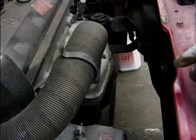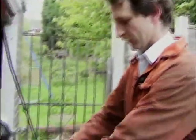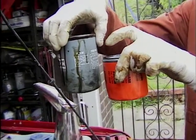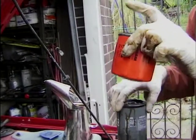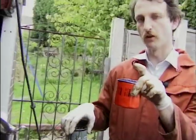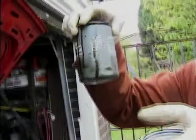That's all cleaned up. Pop the new one back on. Just before I fit it, what I wanted to point out is that these two filters are of different sizes. Normally that would make a difference, apart from the fact that I do know that Volkswagen have changed the specification on oil filters and they've gone for a smaller spec one. So I know that that one's correct, even though I've taken that huge one off.